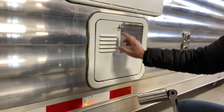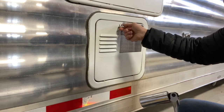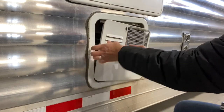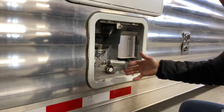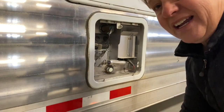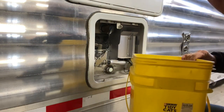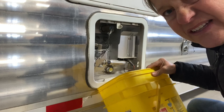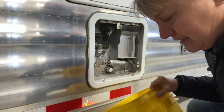So this is the cover for my water heater. It has this little tab here that if I pull this out and twist it, it fits in a slot that allows the cover to come off. Once I get this anode out, the water's going to go out all over. So don't laugh if I get it all over me. I've got a dish pan sitting below here and also a square bucket. I'm going to hold this up here and try to catch as much of the gunk that's going to come out as I can. It always gets all over the floor, so do this somewhere you don't mind it getting kind of messy.